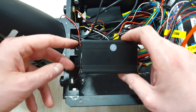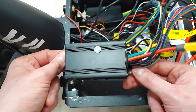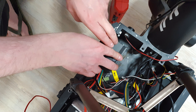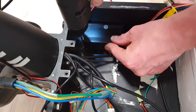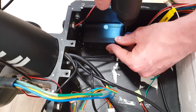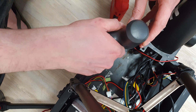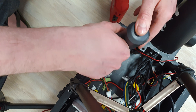To secure this controller I recommend tightening it to the frame. We have to make two holes in the frame — one for this screw and one for the opposite side. For M4 screws you need a drill size of 3.5mm. I want to place my controller somewhere in the corner, like maybe over here. Now we have to drill the hole through this frame. No worries, the frame will not break — it will survive.